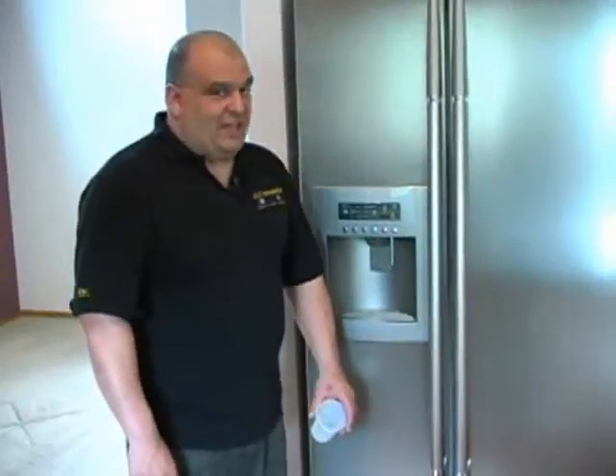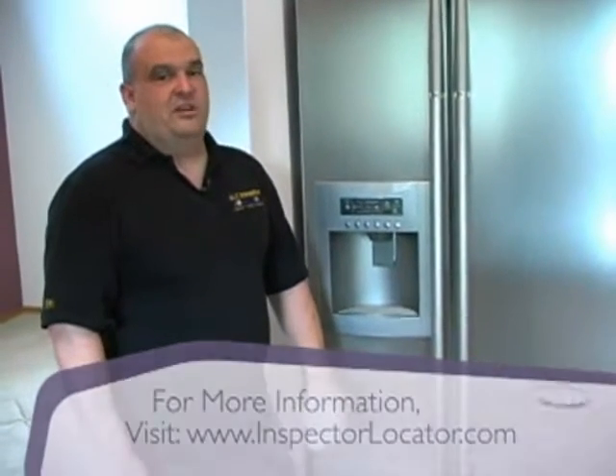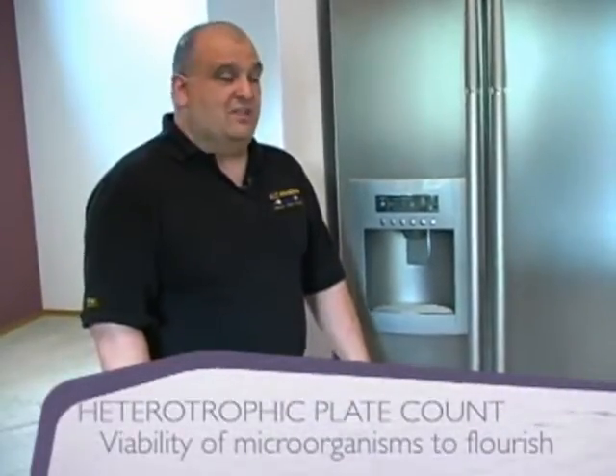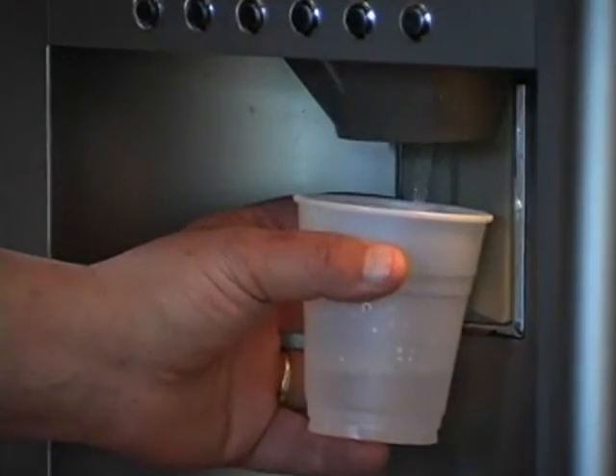Another commonly overlooked source of possible water contamination in a home is right here — water dispensing equipment, such as the type seen on this refrigerator, often have filtration devices attached to them. In fact, some homes use whole house filters. The important thing to remember is that regardless of whether you use a private well or municipal water, there is a real need to change those filters quite often — once every six months or once a year at least, or as the manufacturer suggests. As the filters become old and do their job of removing contaminants, they tend to raise what's called a heterotrophic plate count, which is the viability of all sorts of microorganisms and bacteria to grow and flourish inside the filter. As water passes through that filter, the likelihood that contamination passes out of the filter and into your cup is heightened.